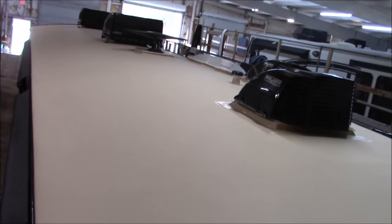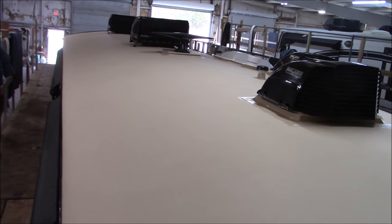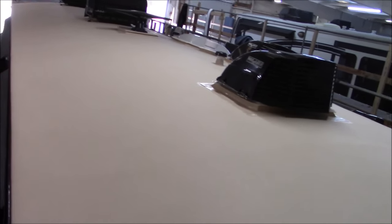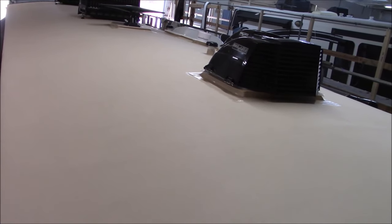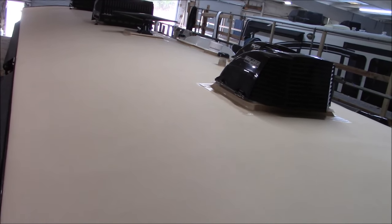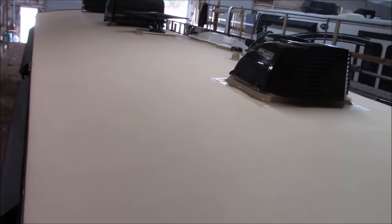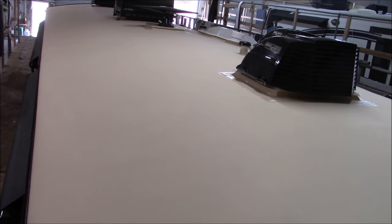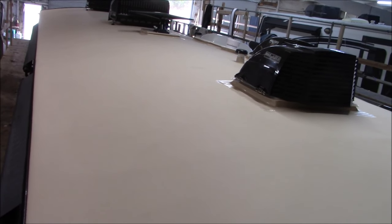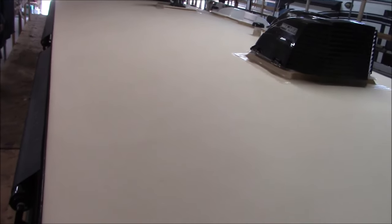This is the TPO roof, which stands for thermoplastic. Thermoplastic gives you the ability to weld things together. There are PVC roofs out there as well. That's another type of product. PVC roofs are expensive, and I know there's probably someone out there going, yo, PVC roof is the way to go. Pound for pound, dollar for dollar, TPO roof is the way you want to go. If it worked better and gave better performance, and it was cost effective, that's the other thing, then I would probably opt for it. But PVC roofs are generally more expensive. The material is designed for chemical plants or where there's going to be some sort of exhaust or fallout that may otherwise deteriorate other roof systems like EPDM rubber or even TPO. That's the purpose of a PVC roof.